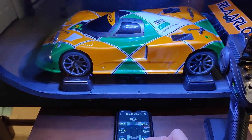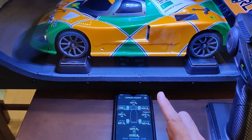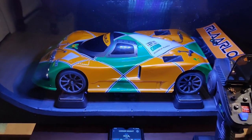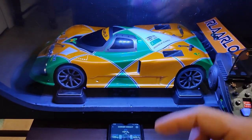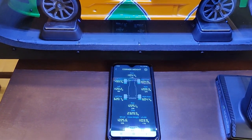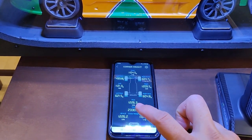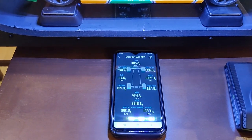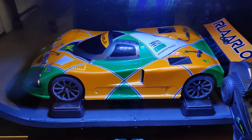That's what had me worried — that I messed it up. But we're going to find out once I make the other wind tunnel and generate much higher speeds. Maybe then we'll get something out of these ducts. But as of right now, I can't say they're doing anything at all — they're not affecting it. It doesn't seem like they're adding any extra downforce on the rear, which is what I was hoping. So at 10 and a half miles an hour, we get nothing out of the ducts. Let's try to get more speed and see what happens.